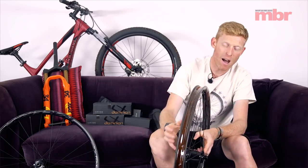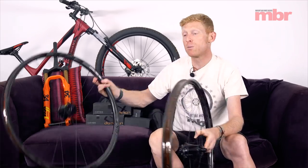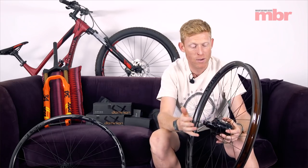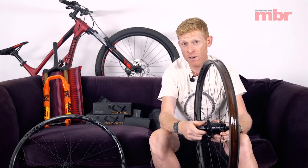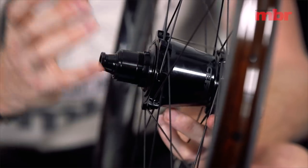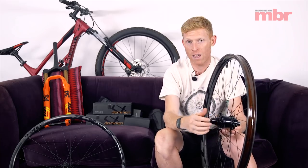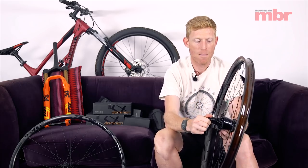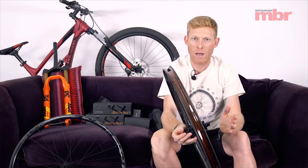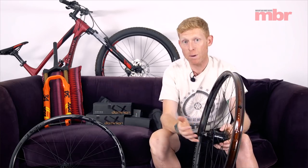It's a pretty cool looking hub — unusual and definitely noticeable, even more so on the rear wheel. We've got the XD driver here for SRAM cassettes, so if you run Eagle or similar this would be perfect. It's got 120 points of pickup, so three-degree engagement — a nice pleasant sound, not really horrible and noisy. It uses three sets of two pawls — six in total — giving that nice buzzy sound and very immediate pickup. Available in 27.5 and 29-inch diameter in all types of spacing including non-boost and boost.